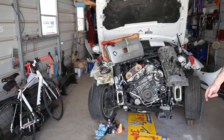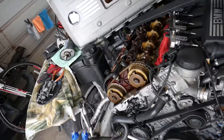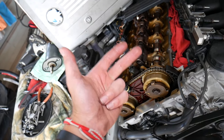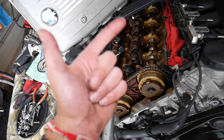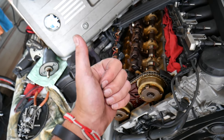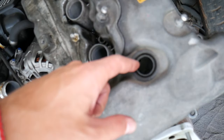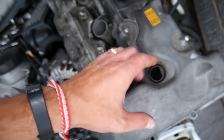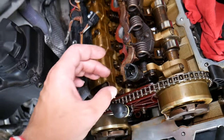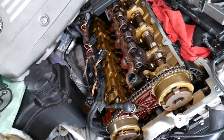This is a six-cylinder engine on a BMW 3 Series, but the same engine has actually been used in the 1 Series, 3 Series, 5 Series, X1, X3, X5, X4, and Z4 — multiple BMWs. Usually on top of your valve cover — it may look different depending on the engine — the connector like that towards the front will be the wire for the eccentric shaft sensor, and the sensor is right here. If you want to see how to remove and replace it, we have a video and I'll put the link in the description below.